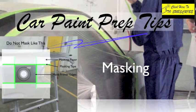One method that I've seen used is back masking, and that's where you flip the paper around so the back edge of the tape makes a softer edge. But still, if you're spraying all the way to that edge, it's going to make an edge that's going to be hard to sand off. So I like the primer to feather out onto the paint, rather than have these squares around it.